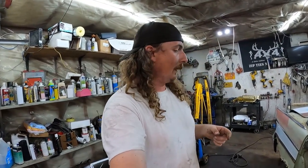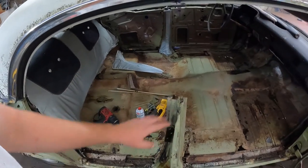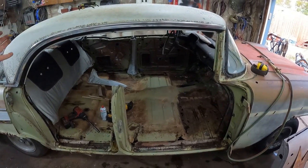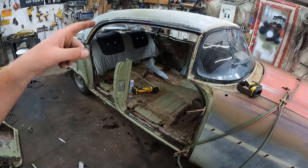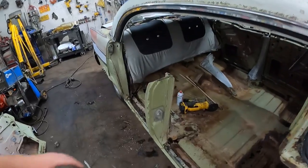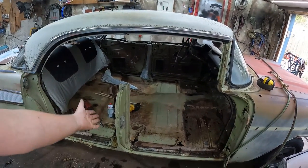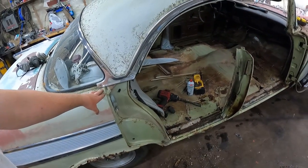I want to get the doors on, get the quarter skin kind of tacked — or the door, whatever you want to call it — tacked once everything fits before I cut the roof off, because we're doing a convertible. Like it or hate it. I think there'll be a lot of bracing going on — from here to there, into the tunnel, whatever it has to be. Might even weld the door shut or put a bar in, do something, because I do think the roof coming off is gonna be something for sure and I don't want it folding up like a pretzel. These hardtops are quite a unit — they got hit on the side, and a nice post top to bottom probably really spreads the load out quite a bit.